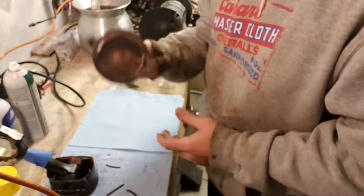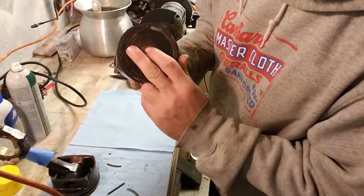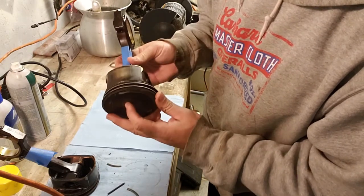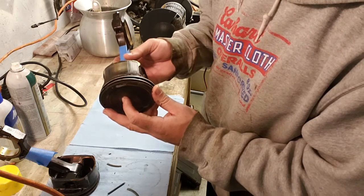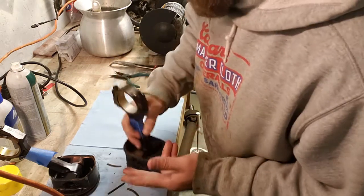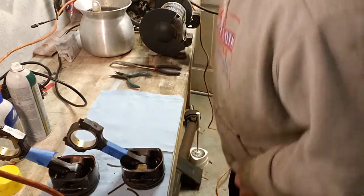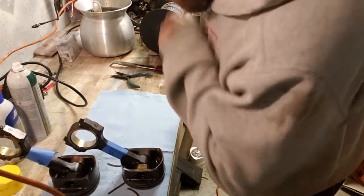Then you'll know, oh, that's the exhaust valve, or that's the intake valve, and I just need to spin it the other way. Your piston's always going to go pin facing forward toward the crank pulley, but you may have this rod on backwards. It's not the end of the world. It'll still work. It's just for oiling purposes. So, a quick tip for everybody. Remember that. And, of course, you're going to forget that now that I said remember it. And that's cool, too. I don't care.